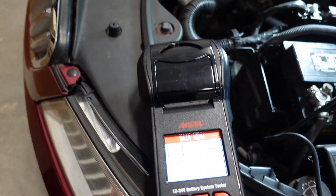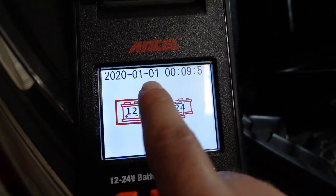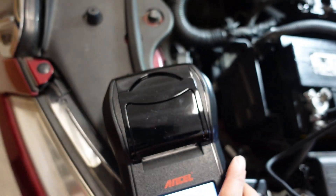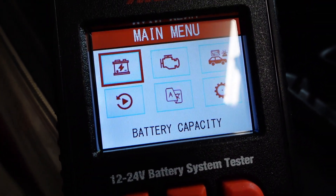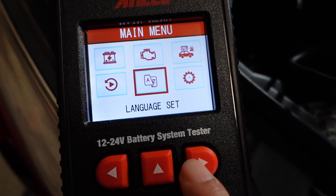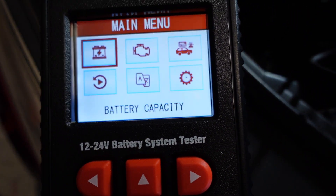Here's the unit. Let's go back to the main menu. You pick either 12 or 24 volt. You can set the date or time if you want, and if you want it to maintain the date and time so you don't have to set it every time you turn it on, there's a CR2032 battery slot right here. You hit the right or left key to go from 24 to 12, then hit the enter key. You can go through battery capacity, cranking test, charging system, data review, language set, and time adjust — those are the only options in the menu.